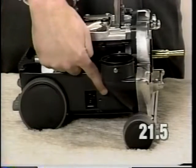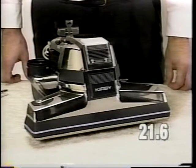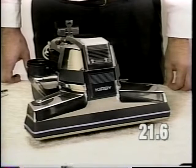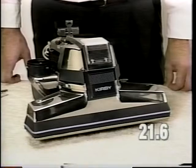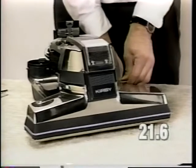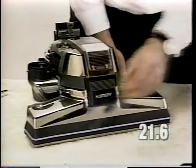The base pan could be bent if the machine was dropped. There could also be a problem with the machining of the fan case or nozzle. To test for this condition, set the unit on a level surface and make sure the nozzle contacts the surface evenly. Lower the nozzle and be sure it touches down on both sides at the same time.